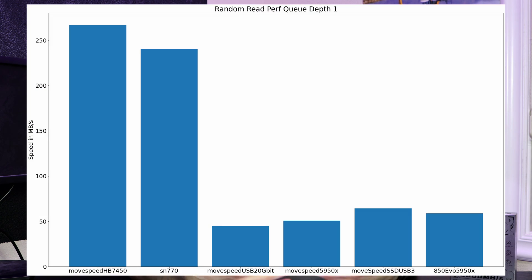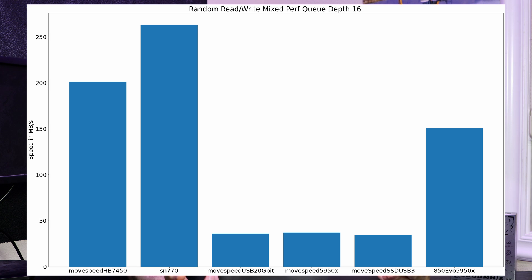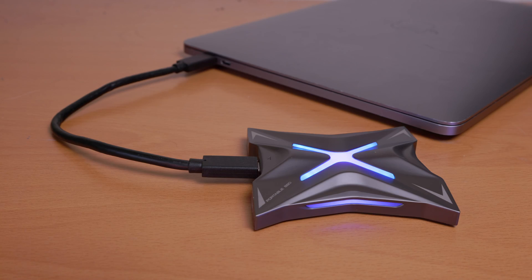Now let's look at random I/O. This drive's random I/O is limited by the nature of being a USB drive — higher overhead and lower IOPS compared to something like an internal NVMe drive. But it's still not bad, with performance relatively comparable to a SATA SSD in most random workloads. So if you wanted to use it as a Windows-to-go drive or something to boot from, it will still perform very well. It'll also work just fine as a game drive and will be more than fast enough for loading almost all games quickly. One other positive is that performance doesn't drop much when the drive is full, unlike many drives that see a significant performance drop-off when full versus empty.